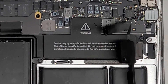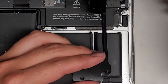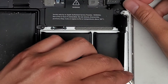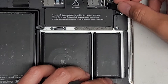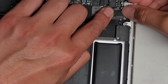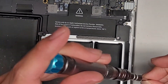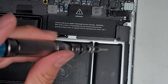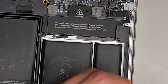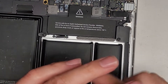We've got the replacement speaker. To put it back, you just do basically the opposite. Angle it like that, get the cable underneath, then drop that down, get the connector, line it up, and push that into place. Then put the T5 screws back. I loosely fit it first to make sure I can get all three screws in, because sometimes it's not aligned properly, then tighten it down.